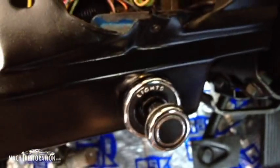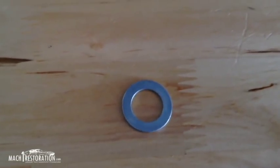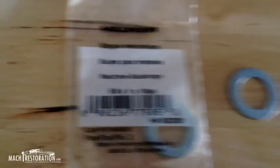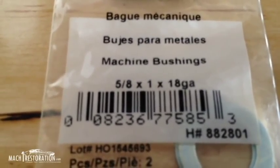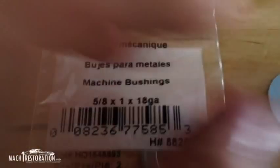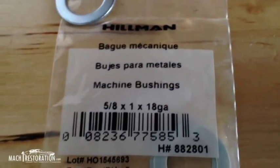I want to share what I did to solve that problem. Home Depot and Lowe's — forget about it, you're not going to find it. What you need to do is go to Northern Tool Supply or a shop that sells machine bushings. A machine bushing is what's going to fit that. Right here is the machine bushing that is the proper bushing to fit inside of that bezel. I bought a couple of extra ones so I can show you guys what you're going to need. This bushing slash washer is going to be the missing link you need to attach that bezel retaining nut to the new 70s bezel. It's a 5/8 by 1 by 18 gauge hole size, and this is virtually the best fit you're going to find without manufacturing your own. 69 cents at Northern Tool Supply.